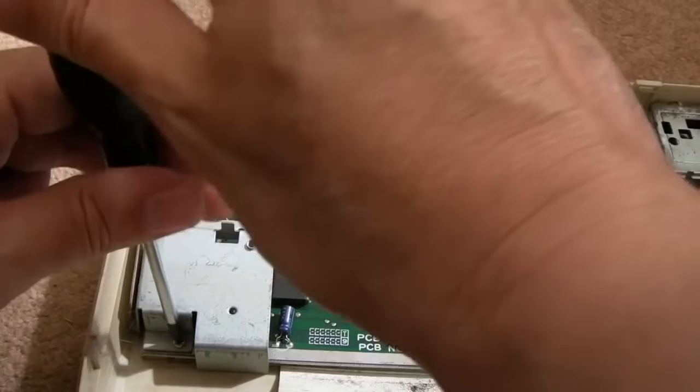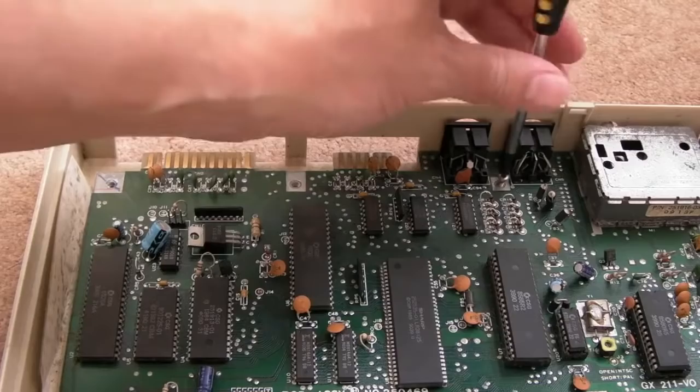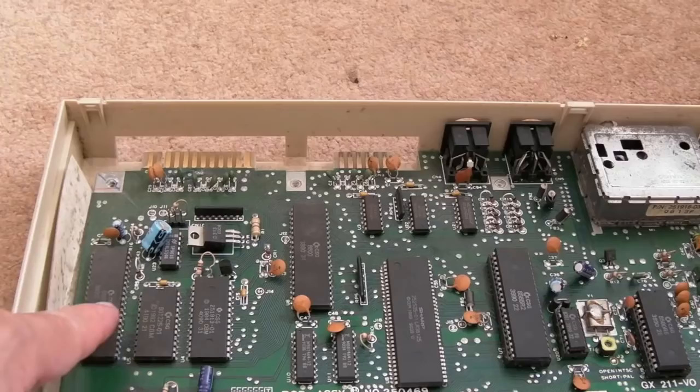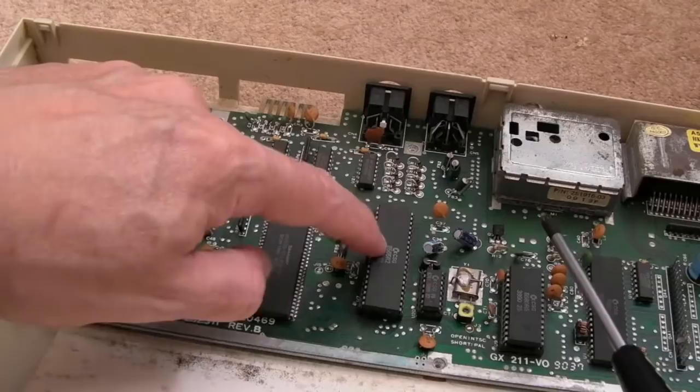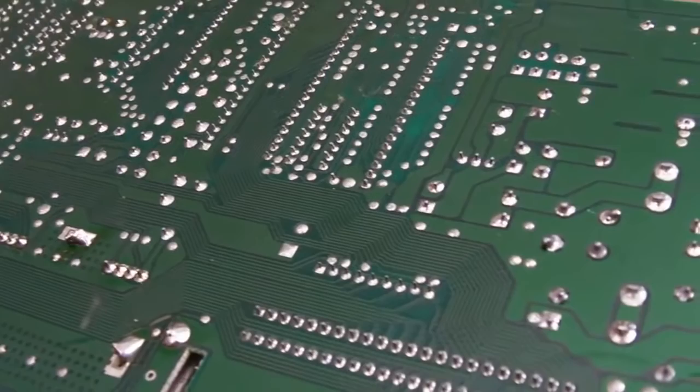So this one's got an 8500 instead of a 6510. Is it the HMOS version, I think, maybe, on these? And both of the CIAs are 6526As on this. 8565R2 VIC, which is no surprise. And our 8580R5 SID. Yeah, so the board's not looking too bad.